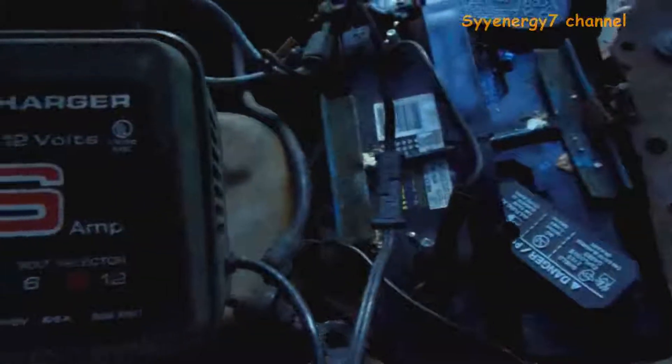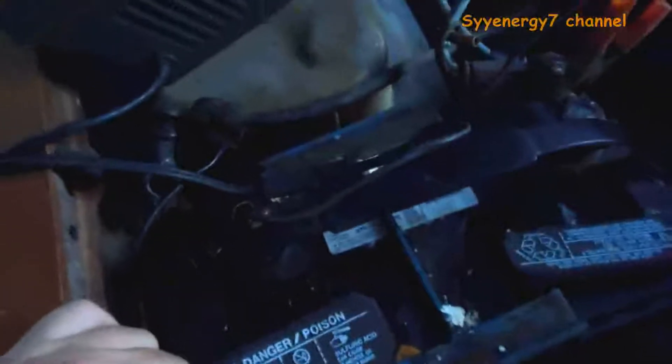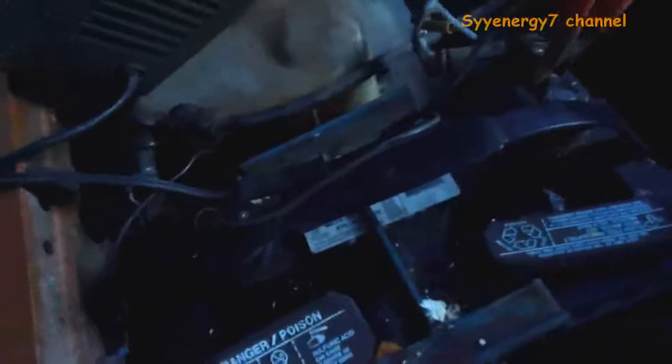Before I do that, I'm going to charge it up with the manual charger — the old-school way. This is strictly a manual charger, so it's not going to go into float mode like an electronic charger would. If it reaches 12.7 or 12.8 volts it'll just keep putting a charge on it. Since the battery's bad anyway I don't care, but I'm going to put the Battery Minder on it after this and see if the desulfation mode works.